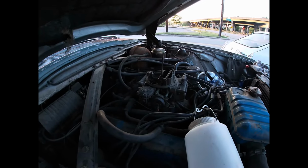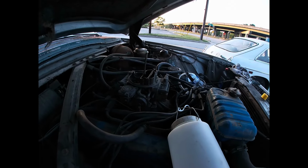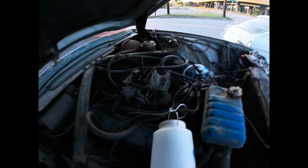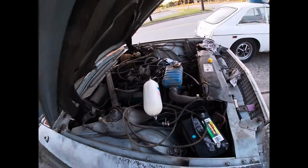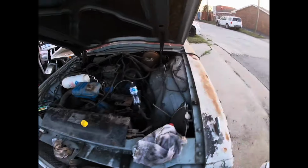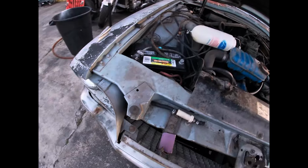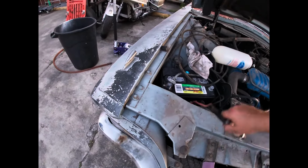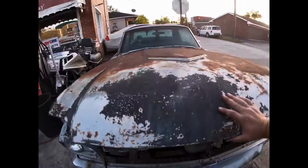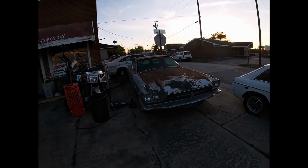And I want to be able to rev it up without it exploding and catching fire. So I'm gonna pull the carburetor off tomorrow and do a quick cleaning and rebuilding and make sure the floats work. And then hopefully it will run better off of more than 6 cylinders. And we'll start another video section. So for now, I am also gonna charge the battery up while I rebuild the carburetor or clean the carburetor. But we're gonna call it good for now.